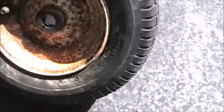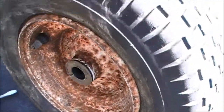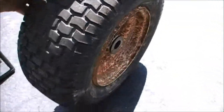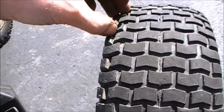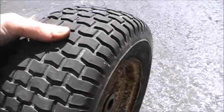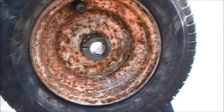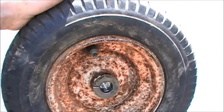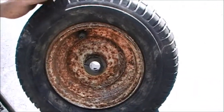The main reason I took this tire off is because this particular tire does not ride well - it's riding kind of like this, tilted. You can see there's more tread on this side than this side; this side's more rounded. Plus it's got a slow leak in it. I also want to take the rim off because these are shot - maybe I can go to TSC and get some new tires.